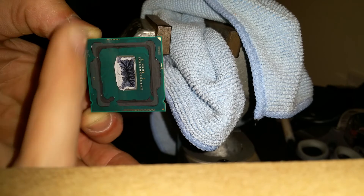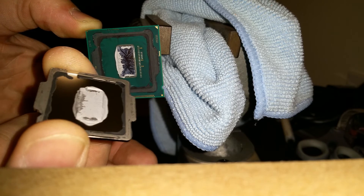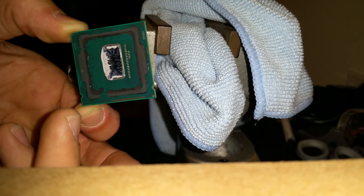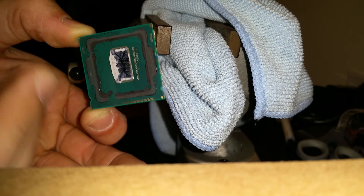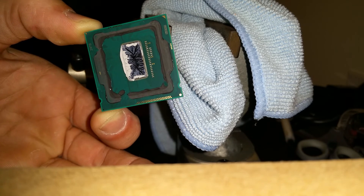Now all you're going to do is take a credit card and clean around here — get all of the epoxy off that was on there. You can remove all of the old thermal material, and then you can use new thermal material. Or as suggested, you can use Cool Laboratory Liquid Ultra or Cool Laboratory Liquid Pro, and put it in between there and on the IHS. Once you're done, you should be able to reduce your temperatures.